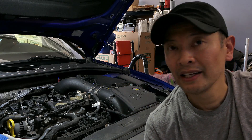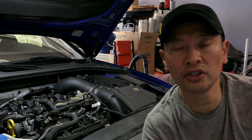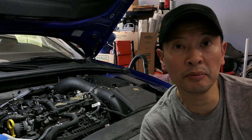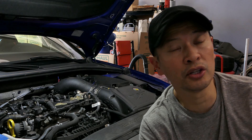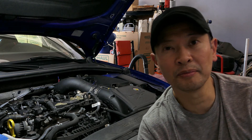Some final thoughts on the coil pack and spark plug change: in all honesty it's not a terribly difficult task and I'm confident you guys can do it. The main challenge you'll run into is just the removal of the coil pack rubber boot from the spark plug. Three of my boots pulled right off the coil pack and I had to muscle them out using alligator needle-nose pliers. The final outcome seems pretty good though — no check engine lights, no funky codes, no noises. I consider this a success with some minor challenges.